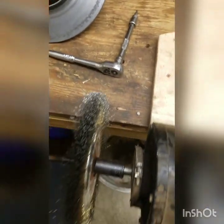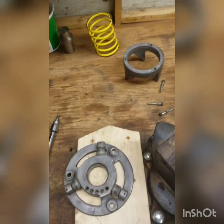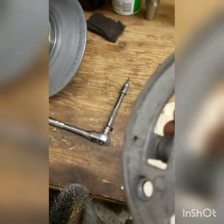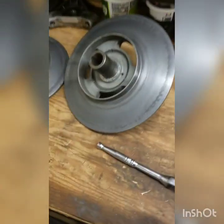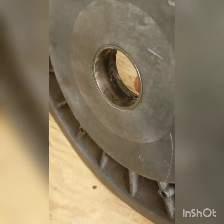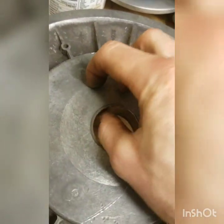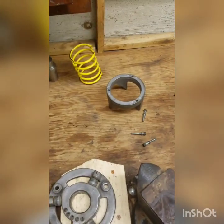One thing to note is typically I won't use the wire wheel on the entire clutch. This is just a clutch off a '98 Powder Special that I picked up — it was corroded from the belt and the sheave, so I hit all that to clean it up. Typically all you'll check is these inside bushings, make sure the rollers aren't completely shot, and then clean up these bearing surfaces because that's what these bearings ride on. You can see a little nick or track there but when you feel it with your hands it's pretty smooth, and that's the main thing. This isn't rocket surgery — we're just looking for good enough.